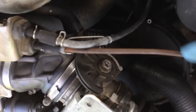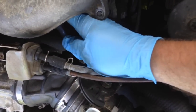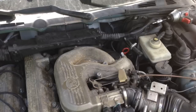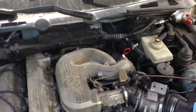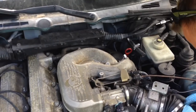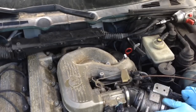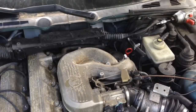So here's where we're at. We're going to go into the back of the throttle body boot — there's a big hose right here that needs to plug into the throttle body boot. Make sure you don't knock that out and make sure it's locked all the way in. That is one thing that is real common to get left undone on these and then it causes a problem. Let's reinstall this stuff, make sure it's seated down good. You might want to rework the mass airflow back in before you bolt it down. Make sure it's all clocked right — there should not be a great deal of resistance anywhere on the system on any of these tubes or hoses.